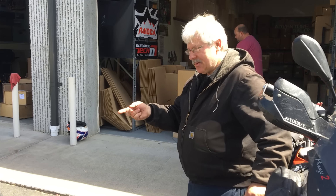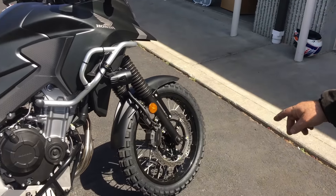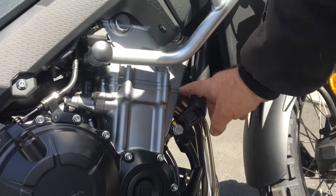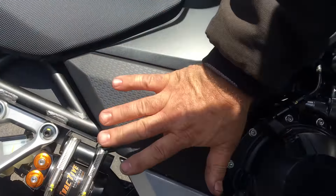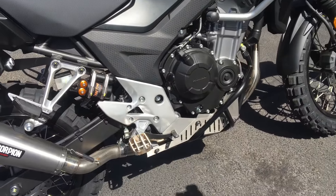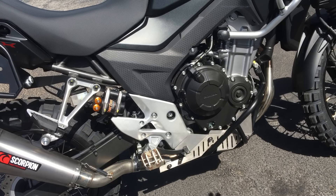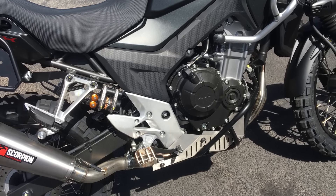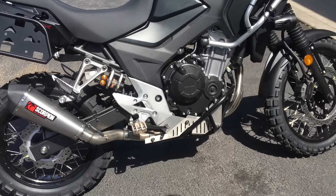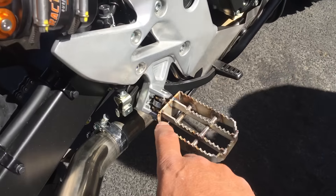Scott, thanks — that looks fantastic, nice work. As a tech tip, I'm using soft ties around that front engine hanger. Show me what you're talking about. So you put a soft tie around the bar frame before you take the bolt out of the stock one, then run it back with all the plastic removed, stack some rubber cushions in there, go around the frame here, and suck it down with a ratchet strap until you remove the bolt. It comes out nice and easy and doesn't move on you.